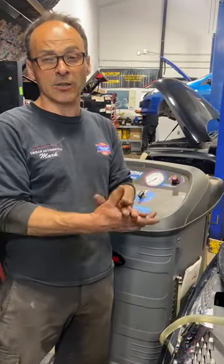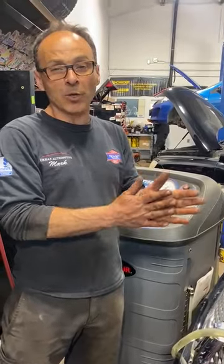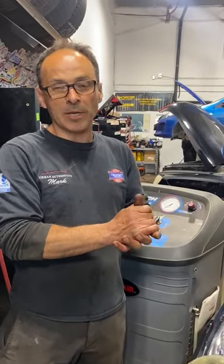It's antifreeze coolant — it's an ethylene glycol. It will break down over time, it may become oxidized, and the pH level gets lowered, so you want to have that checked out every four or five years. It does its job in the winter — it doesn't freeze, hence it's called antifreeze — and in the summertime it cools, hence why some people call it coolant.